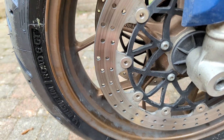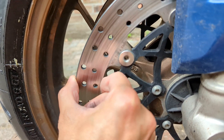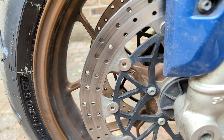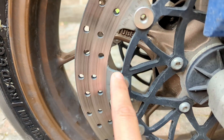That's what we feel when we actually brake. We think the disc may be bent, but not fully — it's just that we need it to be floating. That is the whole purpose of the floating disc: to be a floating disc. So what we are going to do is remove the particles, the dust, and the debris that can get stuck between these three parts.